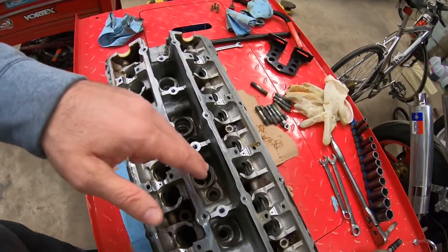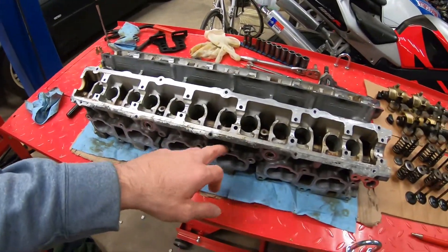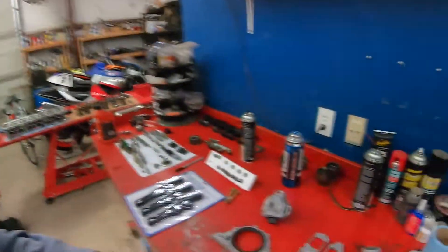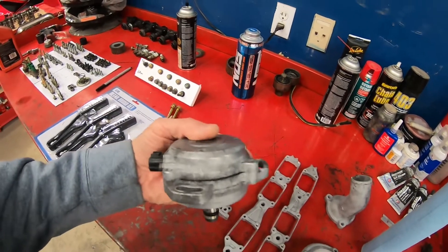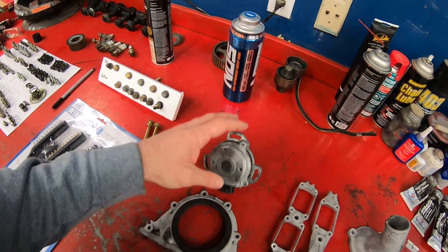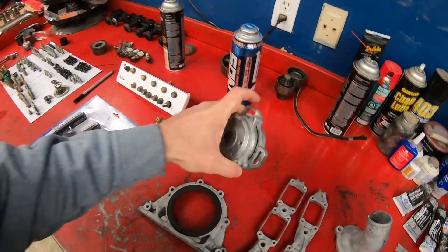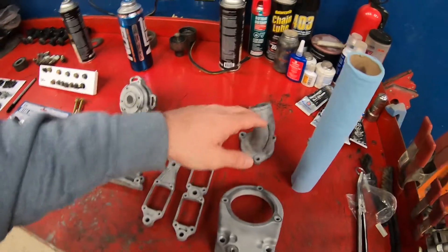The valley is looking a lot cleaner. I still got to go more in detail and get some of the residue out. But looking at the oxidization on this head, I'm going to more than likely have to end up painting it. I did go ahead and media blasted some items on the engine - the rear main assembly, and I got a lot of the oxidization off the cam angle sensor. I had to tape a lot of it off to ensure no media got inside the casing, but it did leave some heavy pitting. So I'm going to repaint the coil brackets, the cam angle sensor bracket, and the thermostat housing outlet.